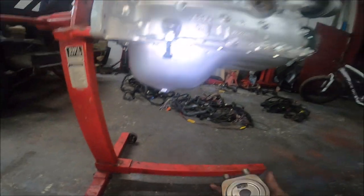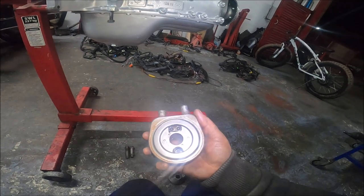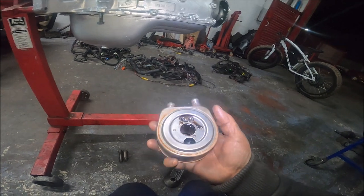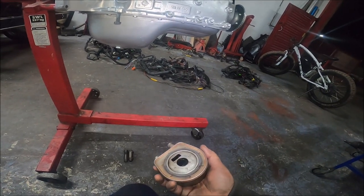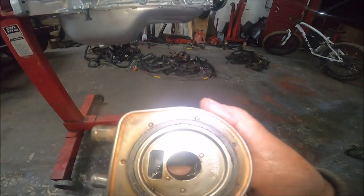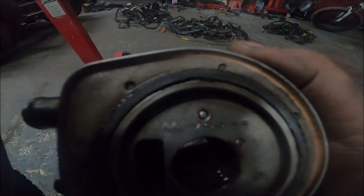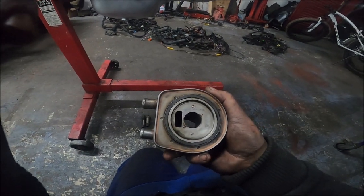This is the original, bloody heavy, water-to-oil cooler. Water goes in and out there — it's a typical cooler inside, oil goes through there, done. It's compact, it's good. And this one — I'm not surprised because everything on these Volvos has been good quality — it's actually made by Modine. It's a proper Modine heat exchanger.